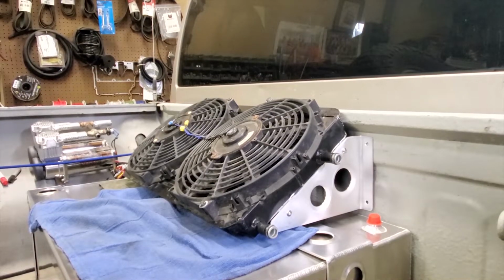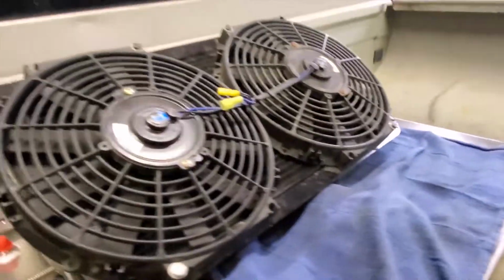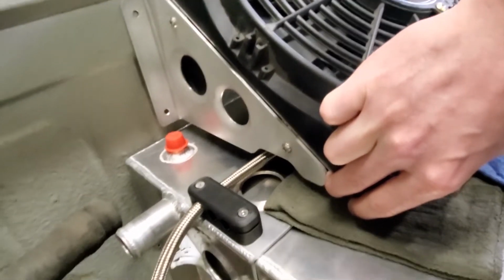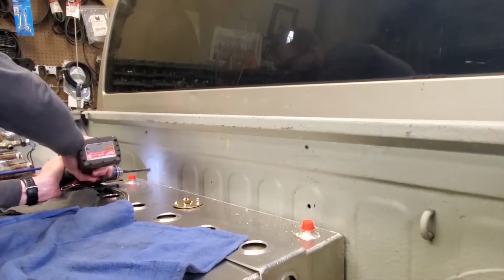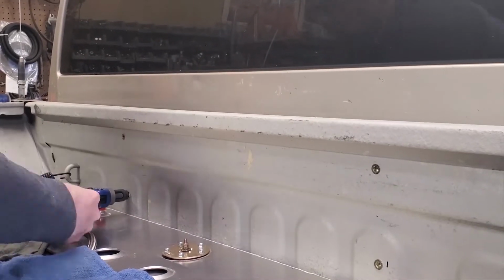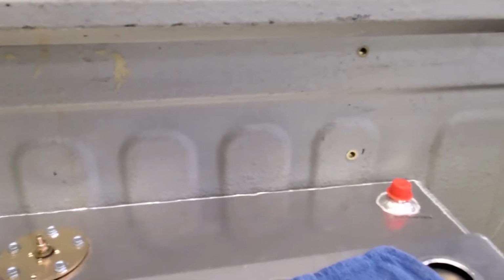That's pretty much how it'll sit. I'll tuck it up against the top ridge of the bed as high as I can, and hopefully it won't go anywhere. You can see on this side where I had to add the notch for the fuel lines. When it sits up where it's supposed to, it'll go right around those. Okay, nutserts are in the bed. Probably need to put a couple little spacers here, but I can do a test fit on the bolt up.